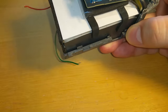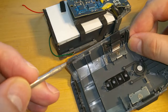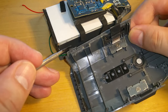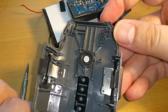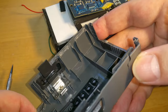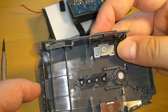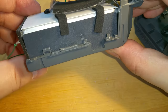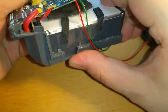The plastic shell is very hard to open without damaging it. Here we can see the last remaining latch after my attempt, and the other side also doesn't look that well. The reason for that is that DJI used sonic welding, so the latches are not the only way of keeping those plastics together. Unless you're lucky and the welding didn't work for your battery, it would be very hard to open it.